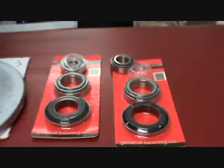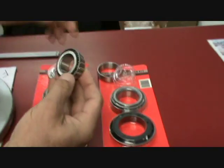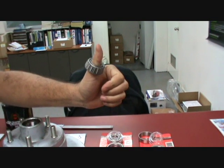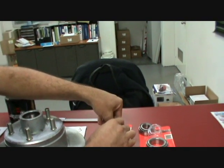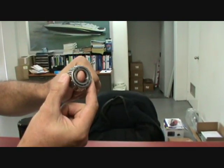The main difference is just the stub sizes. The rule of thumb — literally — is if the outer bearing can go over your thumb, that's a Ford bearing. The Holden bearing is a little bit smaller in diameter, so it won't quite fit over your thumb.